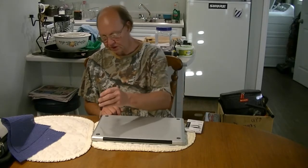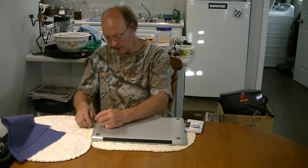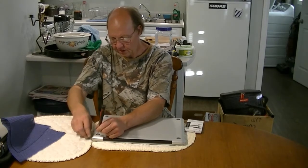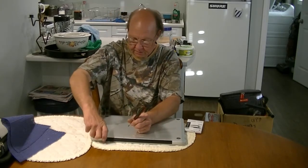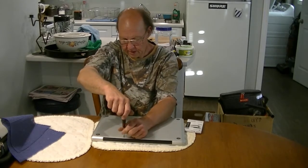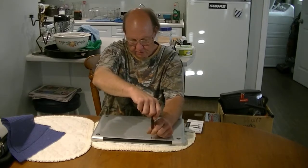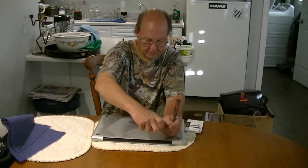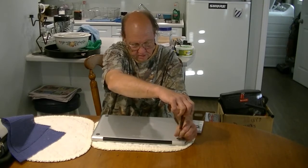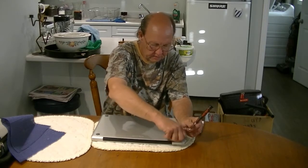You're going to need a really super fine-tip jeweler's screwdriver for this — make sure it fits the screws absolutely perfectly. If it doesn't, you could end up with some problems because these are very small screws. Also, you'll find there are a couple of screws that are a little longer than the others. Do yourself a favor and line them up as you remove them so you know where they go back. There are three long ones — these things are very tiny.